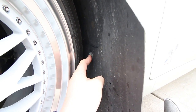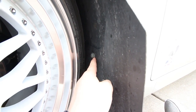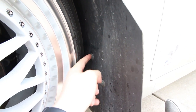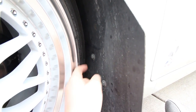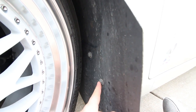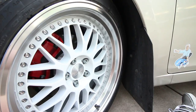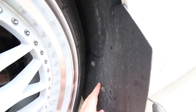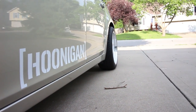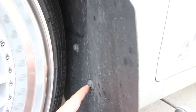I got a quarter-inch bolt and a quarter-inch nut on the other side, and I got two washers so I could put it in between the mudflap and my fender liner. On the other side of the fender liner is the nut that goes onto the bolt — I basically put two of those on there. The front was easy because all you have to do is turn your wheel so you can get access in there. The rear ones though, you're gonna have to take your tire off so you can get in there and drill everything out.